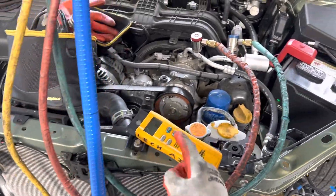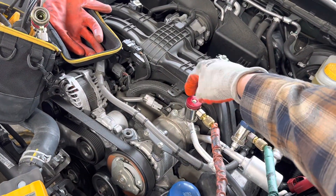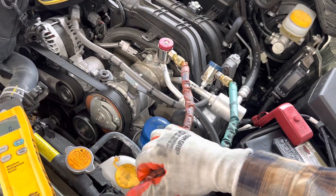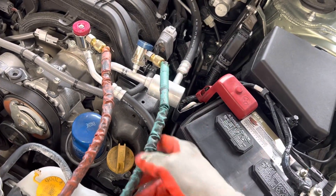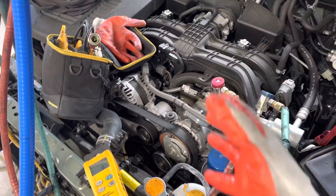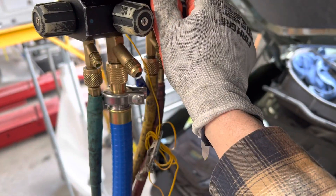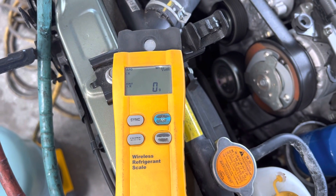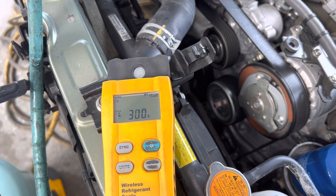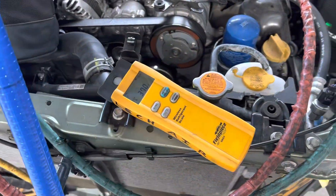Plus the vapor — after you open up your hose and run your vehicle and disconnect your high side, you suck in the liquid refrigerant stored in the high side into the system running under lower pressure, slowly into the low side, removing the liquid refrigerant out of there. So we want 380 grams. I'm going to open and control the flow of the refrigerant right here — one, two, go. We're putting in 380 grams. Done. That's roughly 380 grams plus or minus 10 grams.